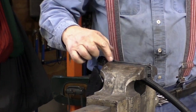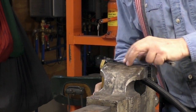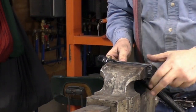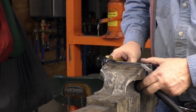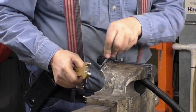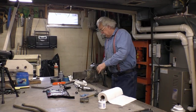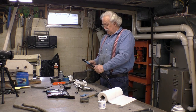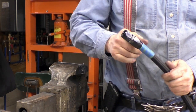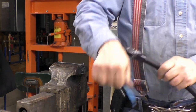What I like to do is line up the flats on both pieces — it just makes it look nice. Let's check it — okay, we're there. Go back half a flat. Yep, that's a snug fit and the flats are nicely lined up. You can see the hose didn't get pushed out of the fitting — that's what the tape indicator is for. When you screw the fitting in, you don't want to push the hose out. Now you know you've got a good fitting.